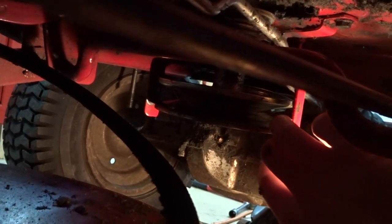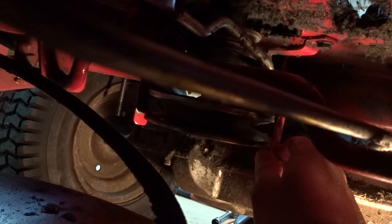I already got the belt halfway installed now. If you go underneath here you can see what I did. Pull the belt out a little bit. You go around this — take the big main belt off that turns the mowing blade on the deck. Take your little belt, you go around this big pulley, kinda pull these tabs — this is the bracket loosened up earlier. Put it around there, pull it up and over. This has gotta be kinda out and then shimmy it up over this tube, bar or whatever you wanna say. Then you can slide it back around that pulley.